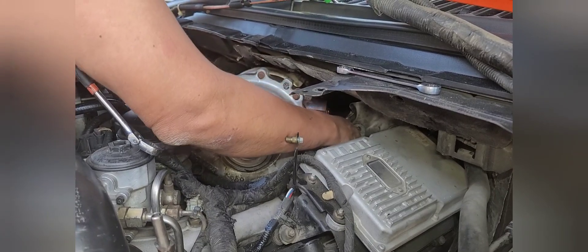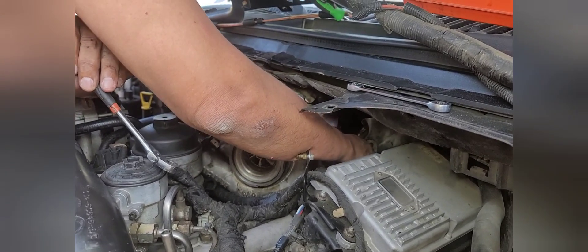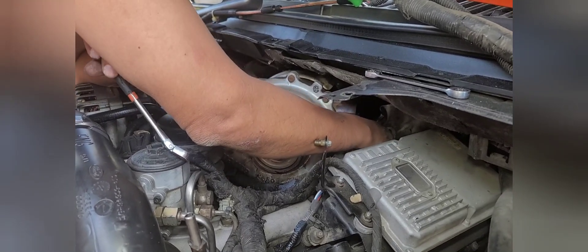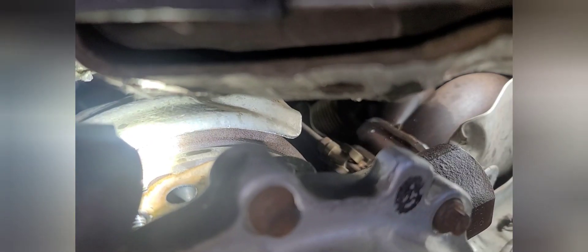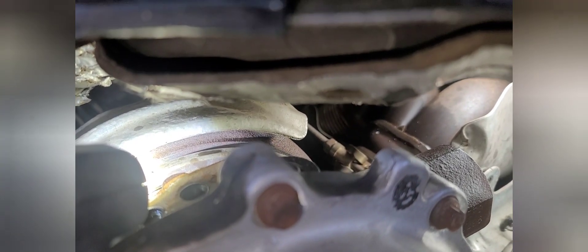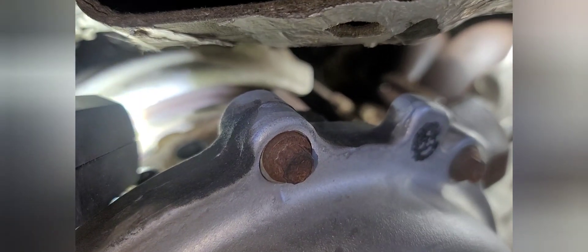Big shoutout to my dude Joey Preciato — he's got a six-liter and someday he's going to need a turbo on it. Hopefully with this video he won't stress out when he has to do it and he'll just knock it out of the park. Next we're going to take off this clamp right here facing toward the firewall. When I put it back on I'm going to turn it around — it's not going to hurt anything, it's just going to make life a whole lot easier for the next person.